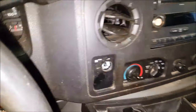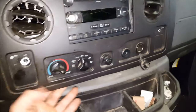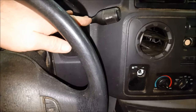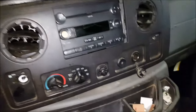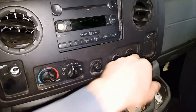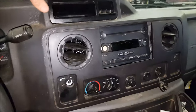If you go around this whole dash piece here and start pulling with your hands, you can get behind here, or you might have to get a plastic tool. But this whole thing literally just has quick clips around the whole thing and the whole piece will just pop off like that. Once you get it to that point, you're going to kind of work it out. You might want to put your steering all the way down, maybe put it in first gear. Get your hands behind there and get the wires off for the jack, your outlets and such, and you've got one switch over here.